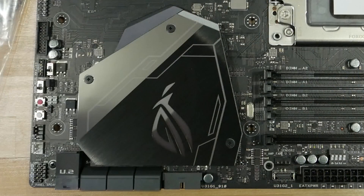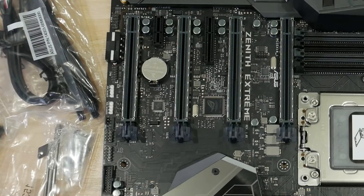We've got three pairs of 6 Gbps SATA ports, the U.2 connector, and front panel connections. There are more fan headers including a water pump header, some analog inputs, and some control switches. Also a USB 3.0 (USB 3.1 Gen 1) front panel header, USB 2 headers, another 4-pin fan header, two RGB headers, a TPM header, a 4-pin Molex power input for GPU auxiliary power, and an HD audio front panel connector.